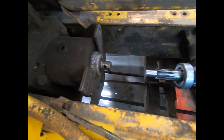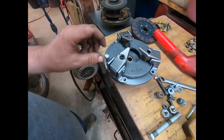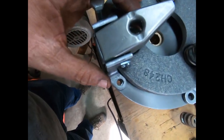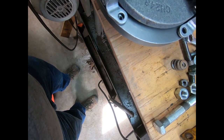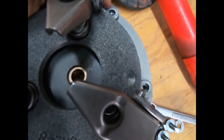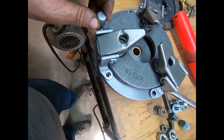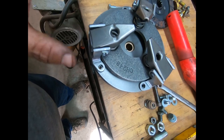As you can see, we're making good progress — everything I put together, I took apart. Here's the problem: I was fighting and fighting with this. I could get all of them started on the same side, but as you can see by that hole right there, it does not line up. You never start one like that — there's just not enough room there. That bolt's got to be way over here, so we're about a sixteenth of an inch off on the width of those holes. So what I need to do is go over to the vice and do a little bit of filing, and bring them together — the same amount on both sides probably.